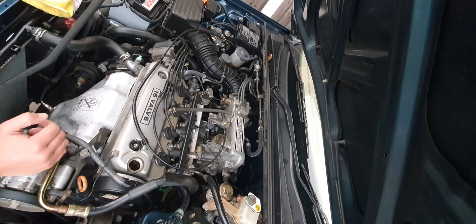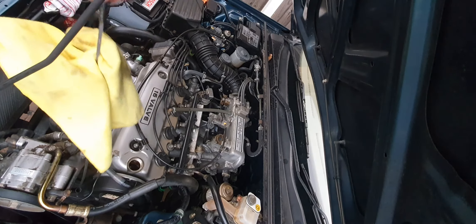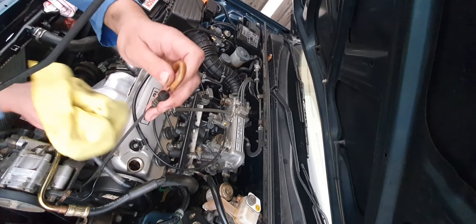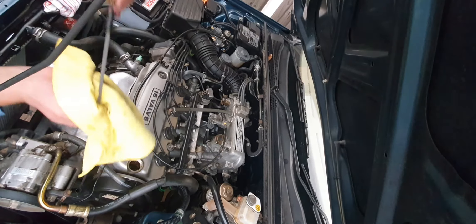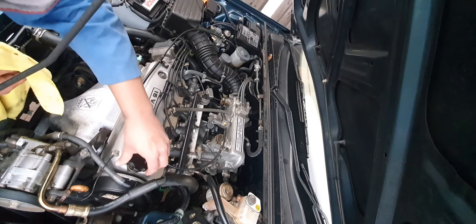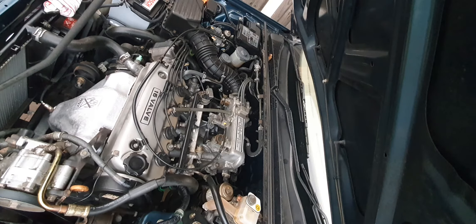So I'll have a quick look at the oil — I can't remember how much I put in, I've been waffling. I think this holds 4.6 litres if memory serves me correctly. Put the oil filler cap on, start it up, fill the oil filter up, and I'll give it a rough check. Bearing in mind I'm still on the ramps, it'll be here for another couple of hours, so I'll top it up properly when it's down.